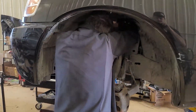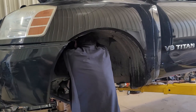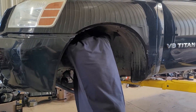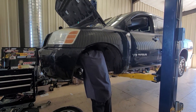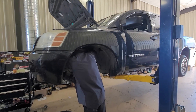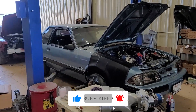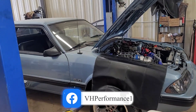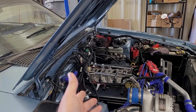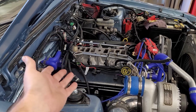This little Nissan Titan had a lot of work — we had to cut off a couple of bolts for the exhaust manifold, which was a nightmare. My guy's been on it for two days now. We finally got those bolts cut off, swapped out, and bolted back up. We also had to pull the intake off because the owner had 24-pound injectors, which were way too small, so we swapped in new 42-pound injectors.